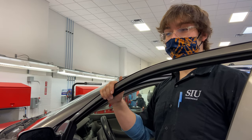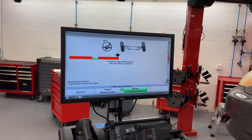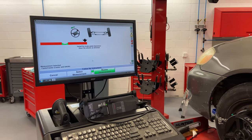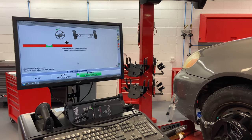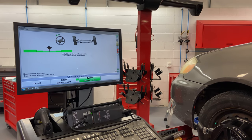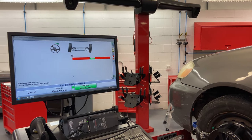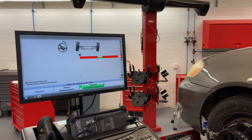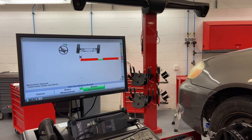I'm going to perform the caster sweep and I'll be gauging the rotation of the tires with the screen. The goal is to get the arrow to line up with the center of the green. It's good to keep in mind to turn the wheel slowly so we don't overflow the power steering reservoir.